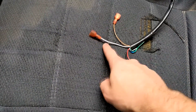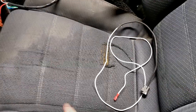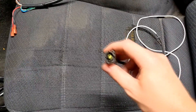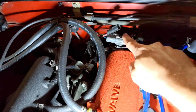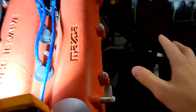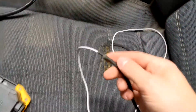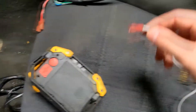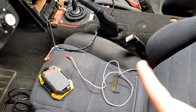With the power taken care of, we now have two wires left. The white is your five-volt positive out and your brown is your five-volt negative out. For the white — your five-volt positive out — I made this cable with white wire specifically to help understand what's going on. This is your stock O2 plug, so your O2 originally plugs in here. The female end is one wire, and that wire runs around and connects up to the O2 which is in your header. It's pretty simple: you snip that off and extend it. I've just soldered them together using white wire. This female spade connects up to the male spade I put on the end of the white — that's your five-volt positive taken care of.